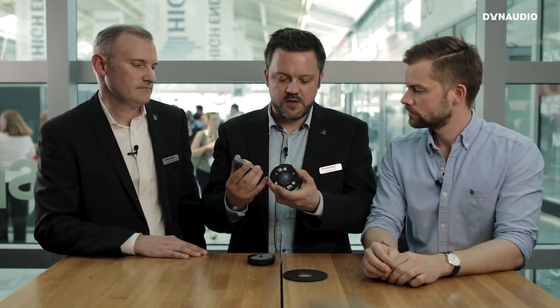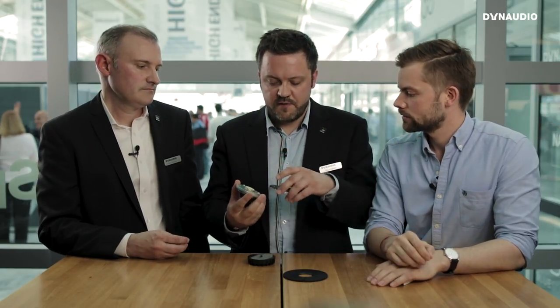The yoke — which is the part where you have the airflow underneath the dome — is redesigned so we have better airflow from the dome backwards. What's actually important is, of course, the sound coming out of the front. But to get the right sound and less distortion, you have to control the sound coming from behind the dome. So the airflow into the yoke piece is different. Could you explain what you have here, because you're talking about a yoke — but is the magnet as well?